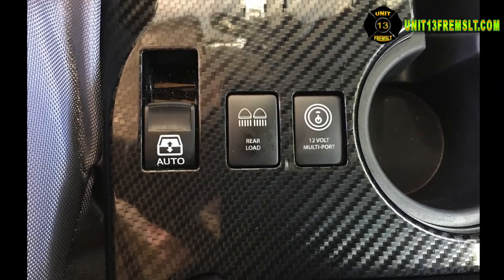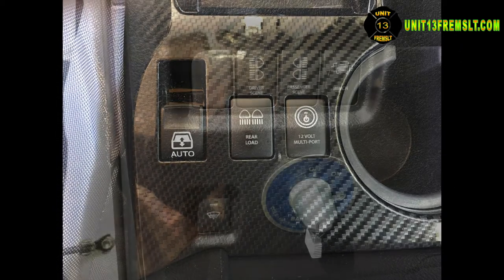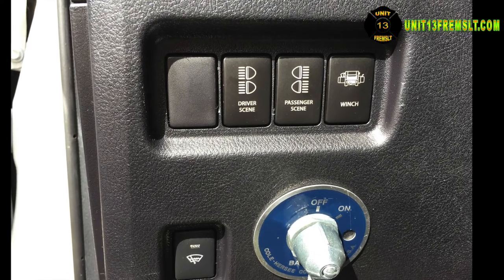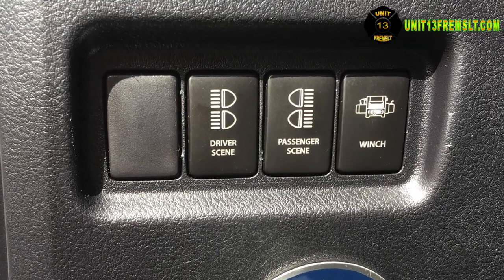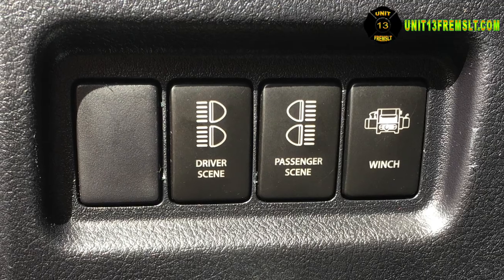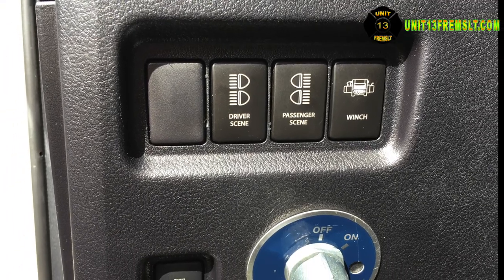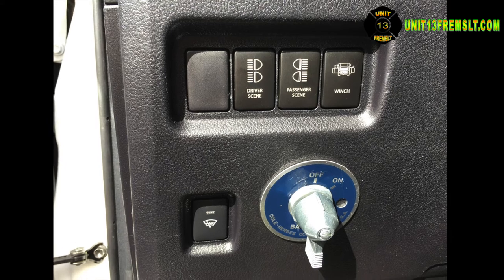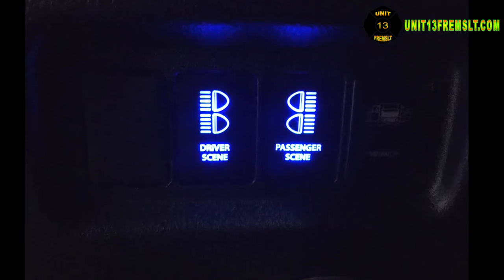The way these were wired, the switch offers a couple of different options. You can have the lighted part of the switch connected to your interior lights so it comes on when you turn your headlights on. However, I chose to wire mine so that when the switch is activated the light comes on, because I want to be able to see that it is on. I don't really need the switch lit up at night — I know where the switches are and can activate them without looking. It's more important to me to glance down and see the light indicating that the accessories are activated.